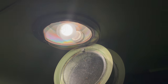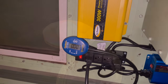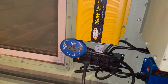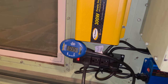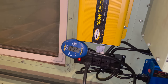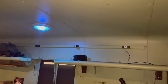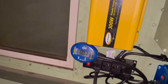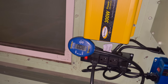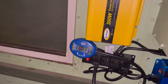Here is a look at the fixture with the old bulb installed, and here it is with the LED installed. As far as the light output is concerned, you cannot tell the difference. I have all the bulbs replaced. Looks like I'm down to 35 watts — that's more than 200 watts less than before. Each bulb now takes about seven to eight watts of power. That's a vast improvement; it's almost insignificant, and I can power a whole lot more inside the vehicle now.